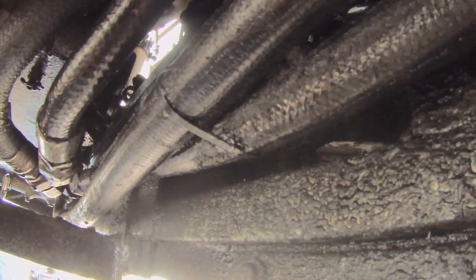See, there's some exposed steel braiding there. It's rubbery there, and it's exposed there. That's where these are rubbing together. I'm thinking that's part of my problem on that one. And they zip tied these together, hopefully to keep them from doing that, but I don't know. I wonder if that made them rub together more. But definitely need new hoses there. Knowing is half the battle. Getting dirty underneath this bus is the other half.